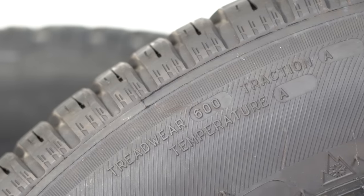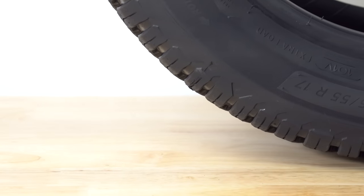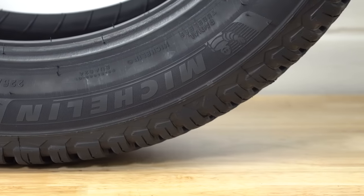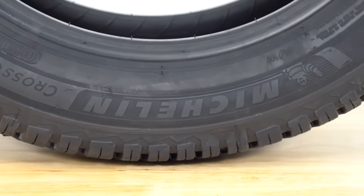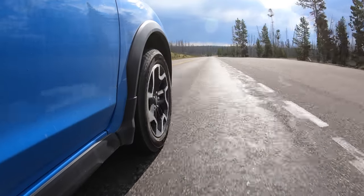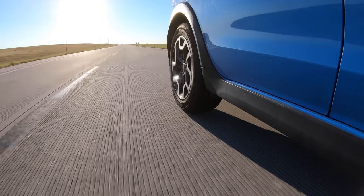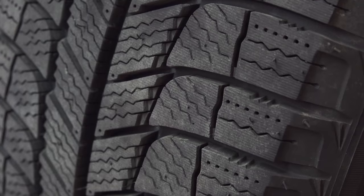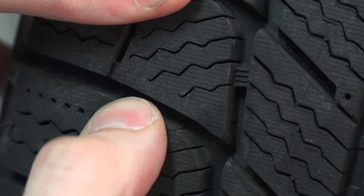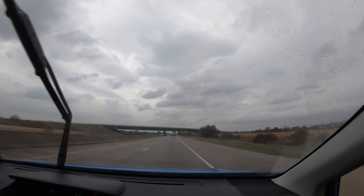Traction between the two is very similar. One might wonder why the tire has a B rating for the UTQG wet traction grade. As it turns out, the UTQG wet traction grade test involves a locked tire sliding on a damp surface — an old test measuring a locked wheel. Today we have ABS, which keeps the tire close to peak friction and prevents locking up, so a locked-wheel panic brake scenario rarely occurs anymore. The test measures locked-wheel performance, but this tire is designed for peak stopping distance when using ABS, which most cars now have. Michelin says there is not a direct correlation between a tire that stops well when locked and a tire's peak level of grip, which always occurs before completely locking up. A winter tire is a good example — good grip, but once sliding, it's less stiff than a summer tire, so it shears off the compound. At the very least, we should have a test demonstrating peak grip rather than sliding grip for wet traction.